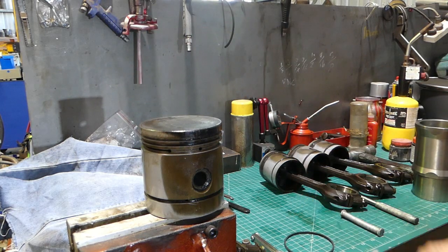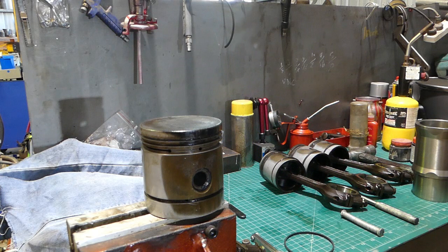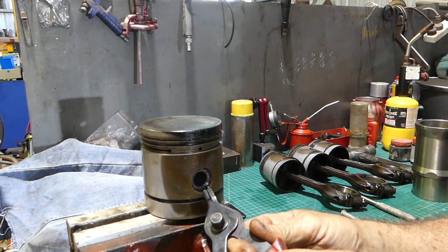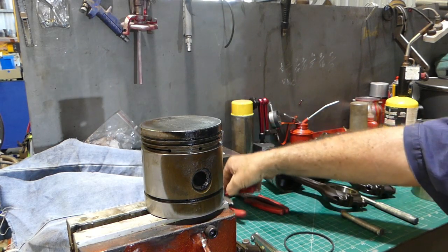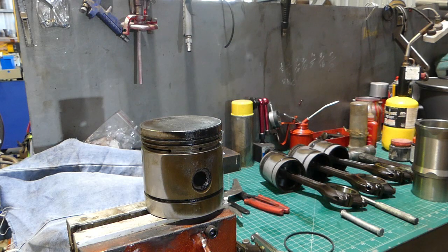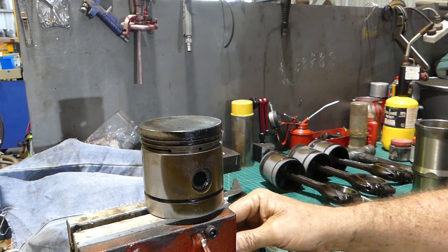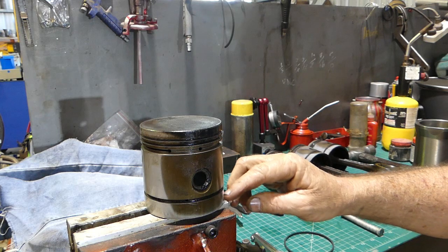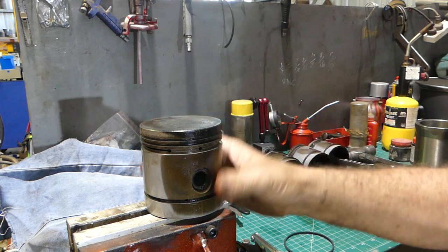Once you've got your rings off your piston, you can do this at this stage or not — it depends entirely on you. To get the piston rings out, I'll just check if these pliers are going to be small enough. I've got this supported in a vise with aluminium jaws. If you haven't got aluminium jaws, just cut a piece of aluminium angle iron for your vise jaws and hang on to your conrod — I like to hang on to the conrod fairly firm.